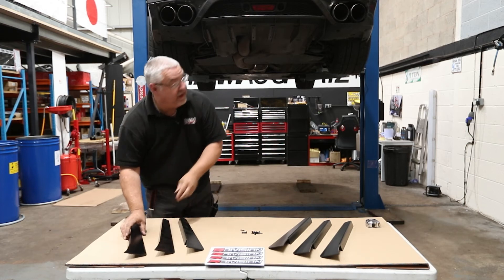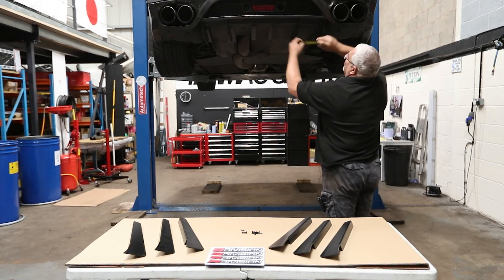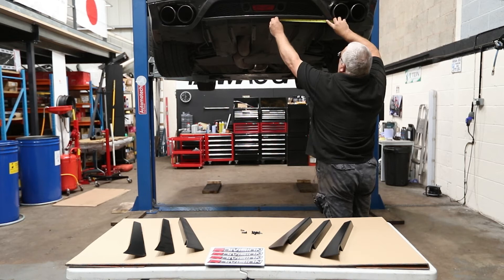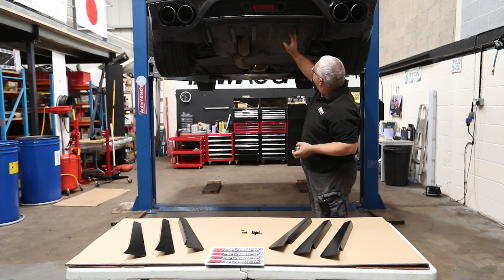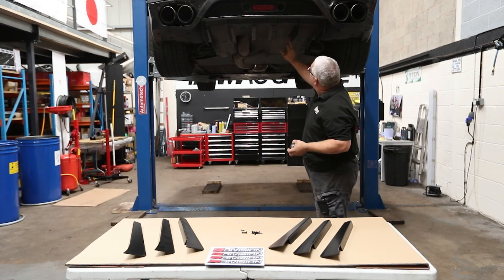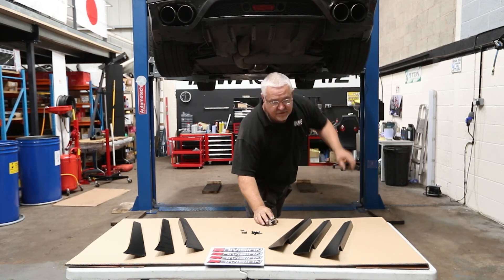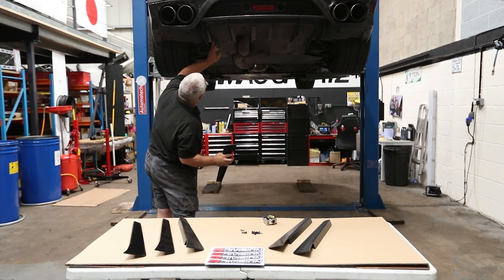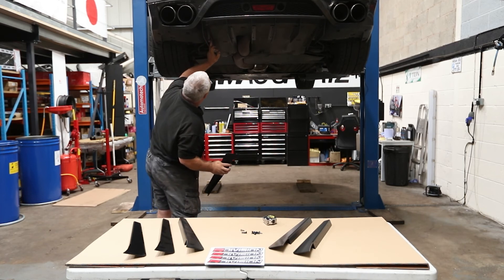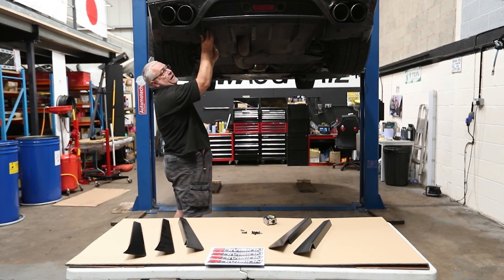What we've opted to do here is we've measured across from the outer right in the corner, and we've got it at 14 inches. From there to there, 14 inches. Same thing again on the CBA — we've drilled with little pilot screws and then self-tappers to hold them. The outer one, with the more angle on it, goes right up against the edge of the little diffuser fin on the edge of the undertray, so that's right in there and that'll give you your start point.